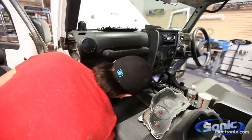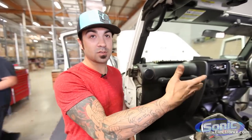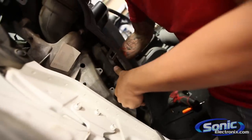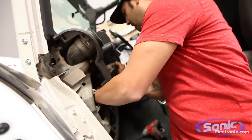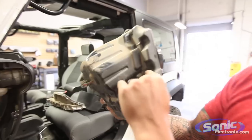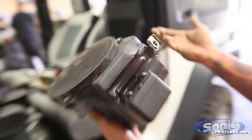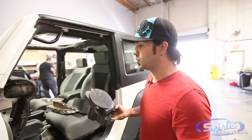So far from the other ones I've done it's pretty much exactly the same except it's just flip-flopped. The glove box is on this side and the steering wheel is on that side — it's just backwards. Now that we've got this unbolted, let's slip this thing out on this side. See, it slides right over and comes right out — this side is definitely a lot easier. So there were two 7mm screws on the side and one 8mm bracket on the bottom, same as the other side. Once they're out, remove your speaker, pop in the new one, put it back.